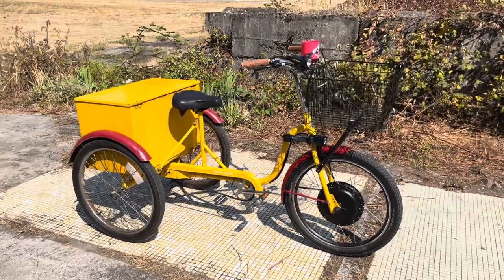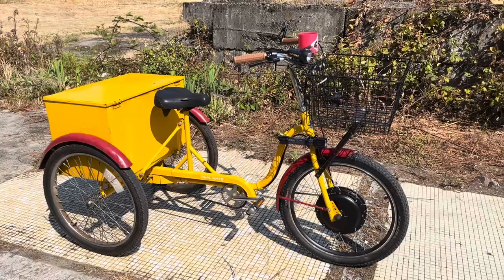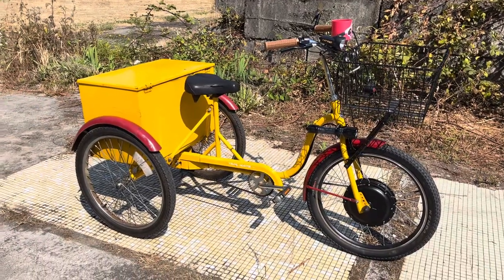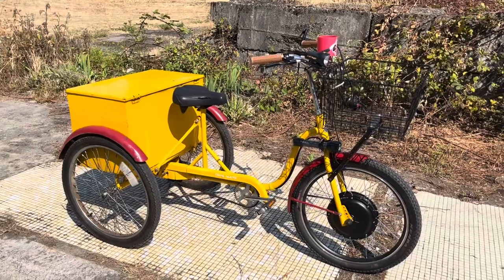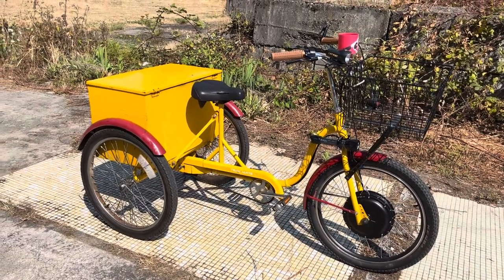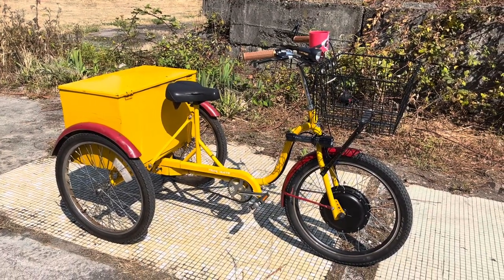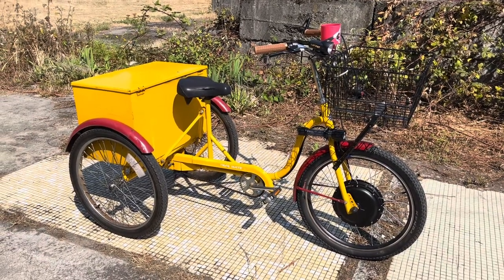This is basically my latest update on the build. We've got front and rear brakes. I overhauled the coaster brake hub yesterday — it was howling really badly — and I'm still getting a little sound under heavy braking on the coaster. I think it needs even more grease than I packed it with. I could probably have just kept on packing grease inside that shell till my heart's content, and perhaps I should have.